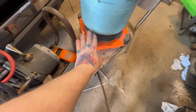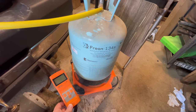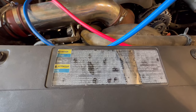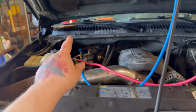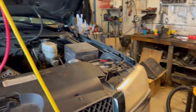I happen to have a scale for my R134a. I'm going to go ahead and look up the spec on how much the capacity is on this AC — sometimes it says right on the vehicle information sticker. Make sure you add the proper amount of PAG oil, whatever type your vehicle takes. I have a handheld oil injector, which is pretty cool.